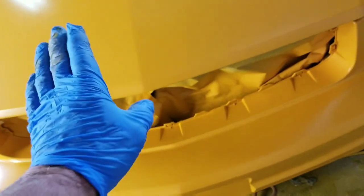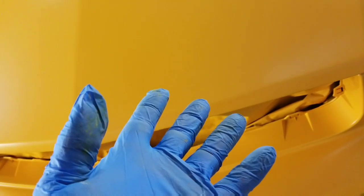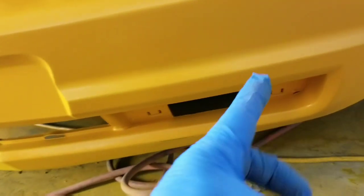And because it's water based paint, I just took a wet rag and wiped it down a little bit. I'm gonna have to put a little bit more paint on that bumper cover. Anyway, the hood had splotches on it and this, that, and the other. So I took the air and blew the water a little bit. The good thing was, this being water based paint, I blew it and saved the hood — just air pressure. Drew my fan down to a dot and blew the water and it faded off into the hood.